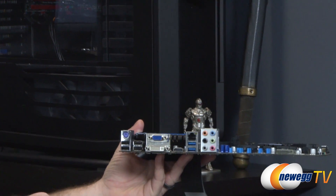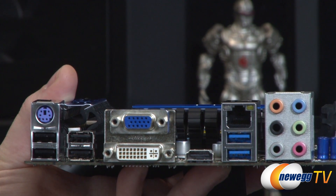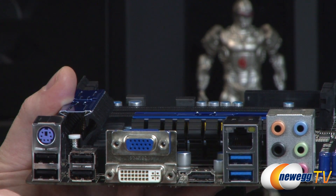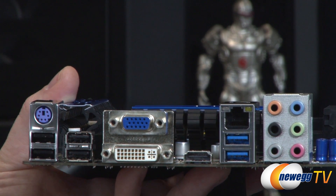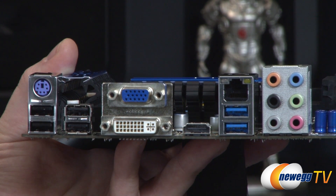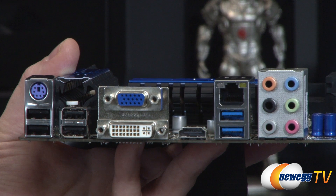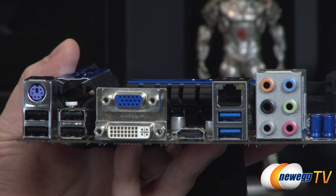Let's finish off with the I/O at the back. First off, you got a combo PS/2 port — that is purple for a keyboard, though purple ports will occasionally still work with mice. You have four USB 2.0 ports. You have your video outputs for the iGPU in your processor — you can set this board up without a discrete graphics card and get DVI, VGA, as well as HDMI out. An upgrade from Ivy Bridge to Haswell is that you can actually support triple display using the iGPU, which is a pretty cool feature. A couple more USB 3.0 ports — natively supported by the Z87 chipset. LAN is provided by a Realtek RTL8111F NIC. And finally, your analog audio microphone input as well as all your outputs for 7.1 channel audio supported by the Realtek ALC898 chip.